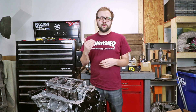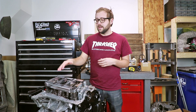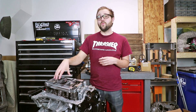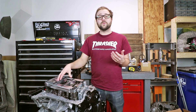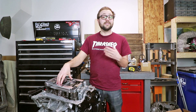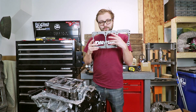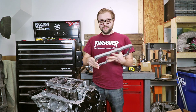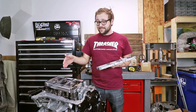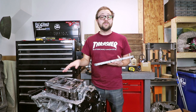Now if you've been following along with the build, you'll remember back in part 1 of this series when I installed the pistons and the crankshaft, I threw in this much larger Dynasty girdle, but I really didn't go into explanation of why I made this upgrade. The reason is pretty simple — this Dynasty piece is a lot thicker and more robust than the stock piece that comes on a VQ35. The original girdle is a cast piece of aluminum, and when you compare the Dynasty to it, you can see that the Dynasty piece is at least two to three times as thick, mostly because it is machined out of a solid piece of aluminum.